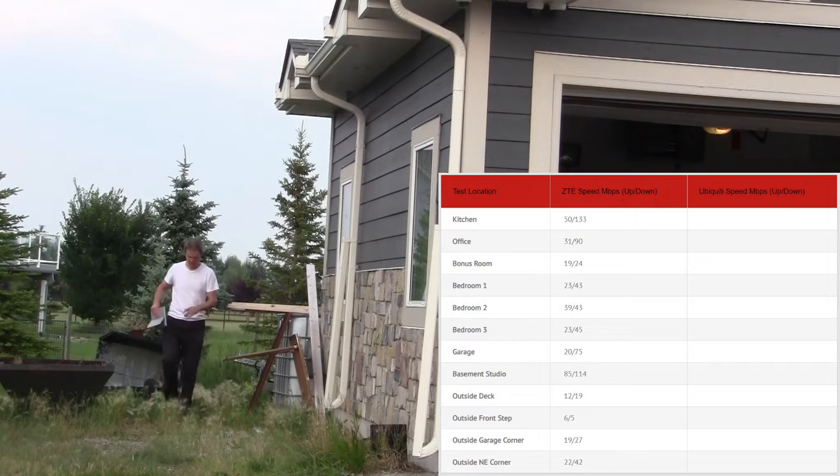This is just the E version of the Pro access point, so you will not find a POE power injector or power supply inside the box, and there are also no Ethernet cables. I'll be using the same POE switch to power the devices that I use for my IP security cameras, which is an 802.3af device like this one right here.